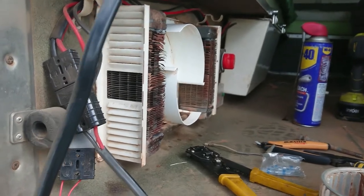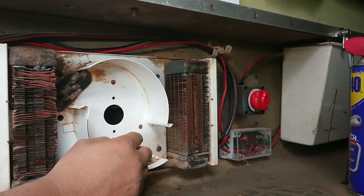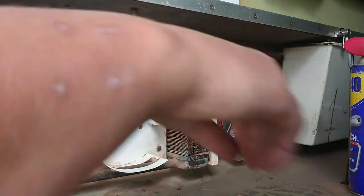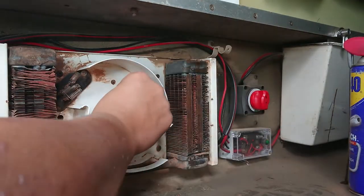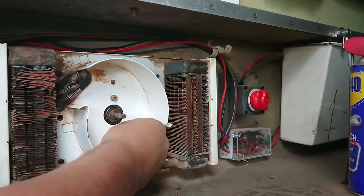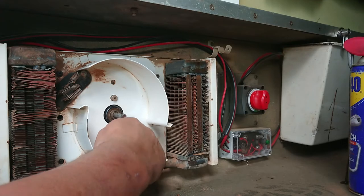I think that's on, so now I'm going to go and pick the motor up from inside that hole down there and try and position it and get those washers and nuts back on. Let's see if it works. There's our nut and bolt there - there's one, there's two. We had a washer, a spring washer, and then a nut on each of these. Before I put all this together, I'm thinking I might leave the fan off for a second and go put the fan relay in, which involves removing a flasher can and modifying it so they can fit next to each other. Then we'll see if we can make this actually spin before I do much else.